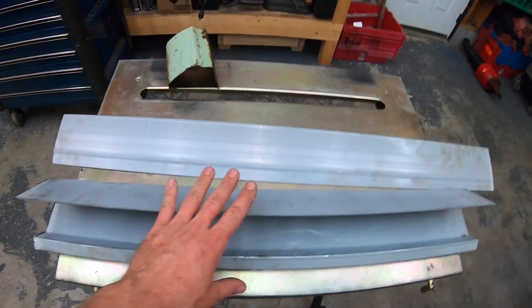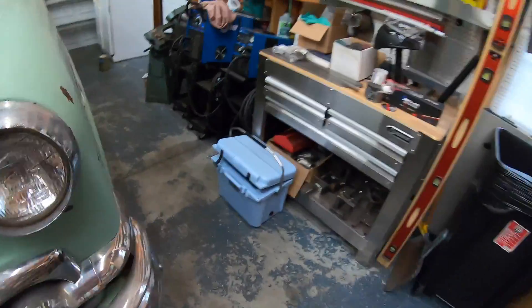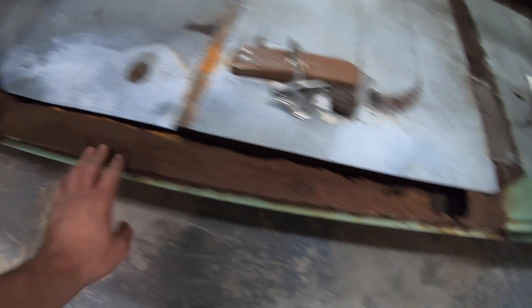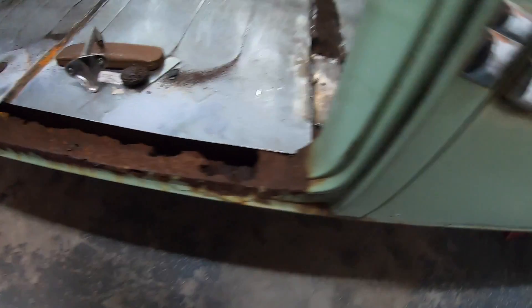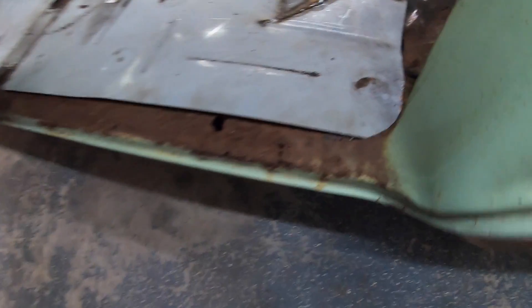This stuff is close - real close when you line it up with the old stuff. But even this was a good piece and it's still got rust in it, holes and stuff. Come over here to the driver's side and show you what I'm scared about. There is absolutely no structure left in this rocker panel, but I plan to replace it the same way I did the other side - cut it right here at the B pillar, cut it at the A pillar, and replace it all as one section. This part is still solid, but you can see someone started putting Bondo back here, so that one's probably going to be replaced as well. You can see it's rotted out up in here.